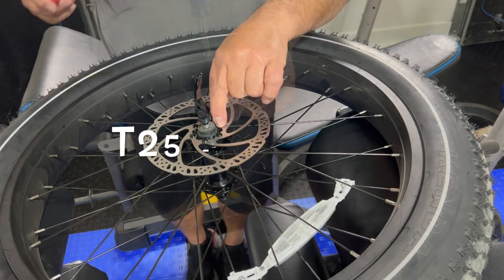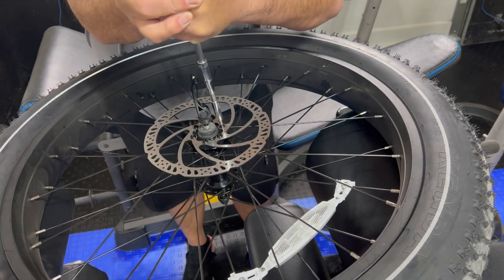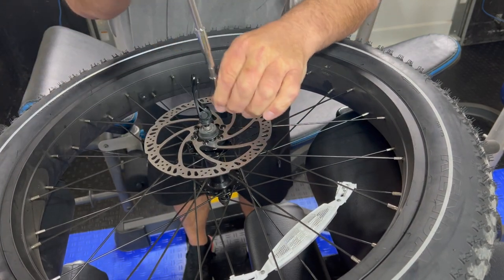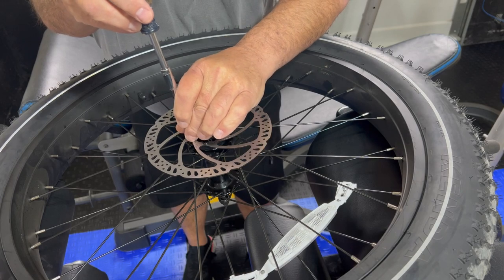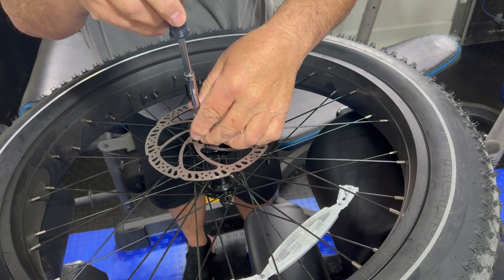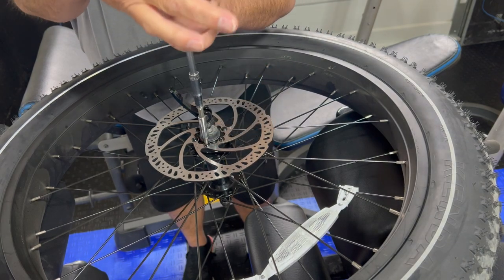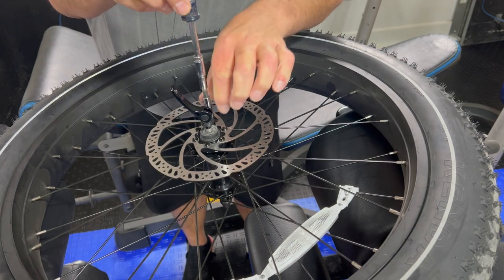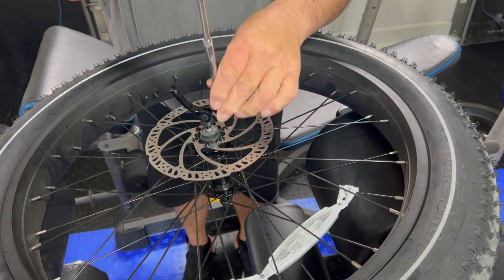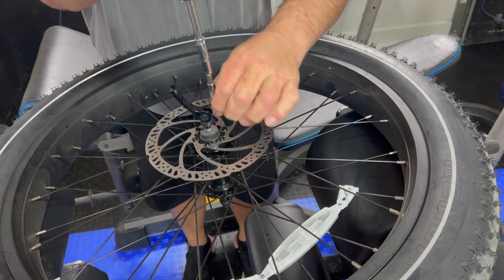These are star bits. Now we're gonna put the T's in. This is much nicer fit. And we're gonna go around in a pattern, and we're gonna do it a couple of times. And I don't know if you can see the actual movement or not, but I can certainly feel it. Okay, they all been gone over once. Now we'll go over them a second time and make sure we get very little movement.